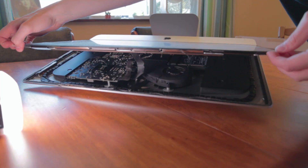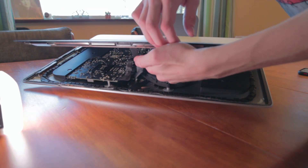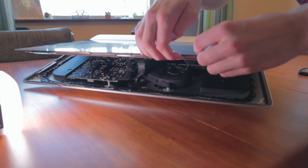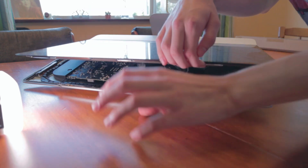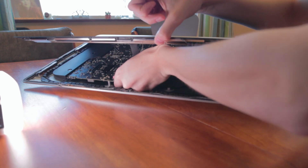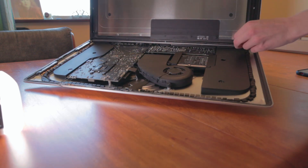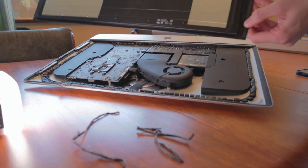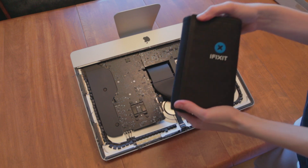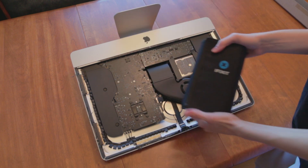So I have here the iMac display unadhered to the frame. However, you'll notice that there are two cables — one here and one over here. This one sends the data to the display so that you can see it, and this one sends the power so that the display can show what's happening. If you're ever working on an iMac, do not touch the power supply. There's a good chance it will shock you, and the shock it gives you will most likely be fatal. So I'm just going to pull it upwards and grab this little tab in the corner of adhesive, and there's the whole display assembly. Okay, so I have the trusty iFixit kit — I can link these down in the description. This is the Pro-Tech toolkit, probably the best bang for your buck from iFixit.